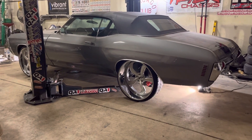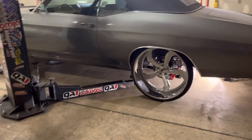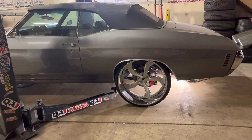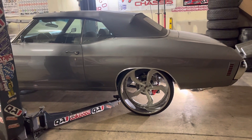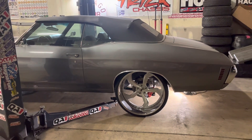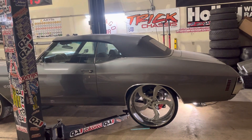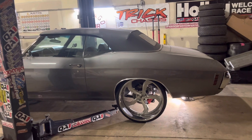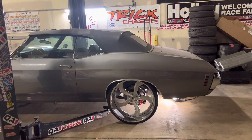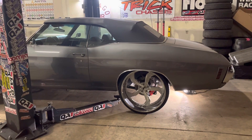This car originally was a bolt-in coilover setup in the back, and that's a 12-inch coilover. With me having to put the cross brace in there, it's way lower in person than on the camera, especially with the light underneath there. Bolt-in coilovers are longer because you've got a lot more distance to travel from the mount on the rear end side and where it mounts up into the car. So I put the cross brace in it — we can bring the S-end down.